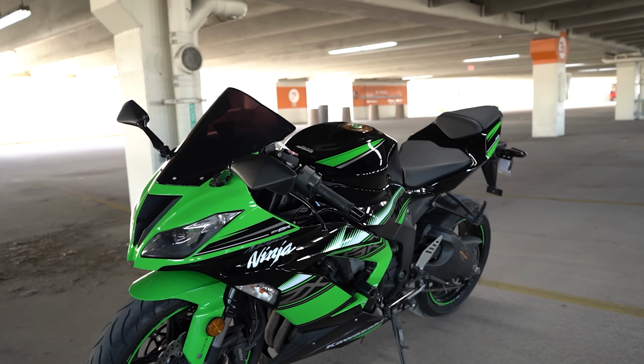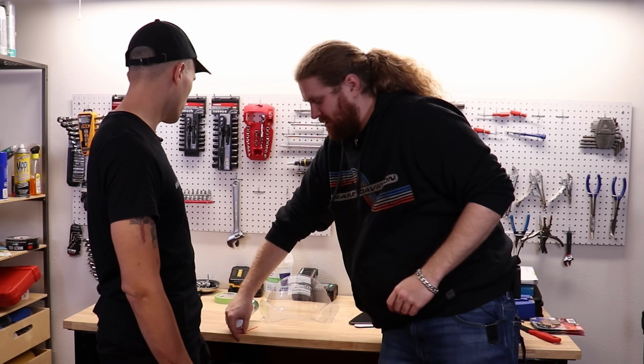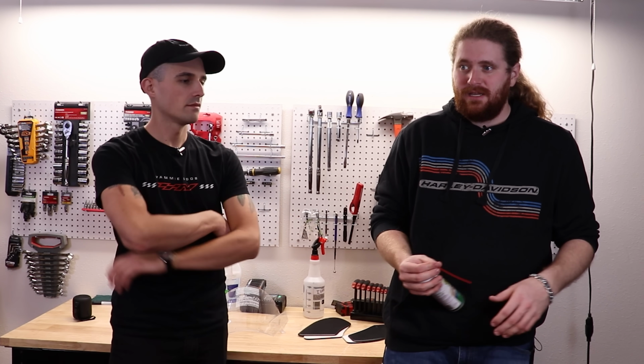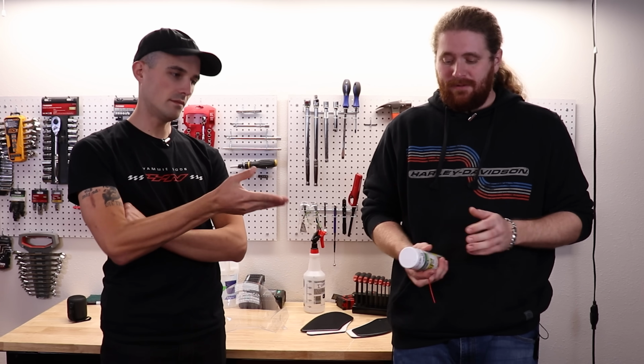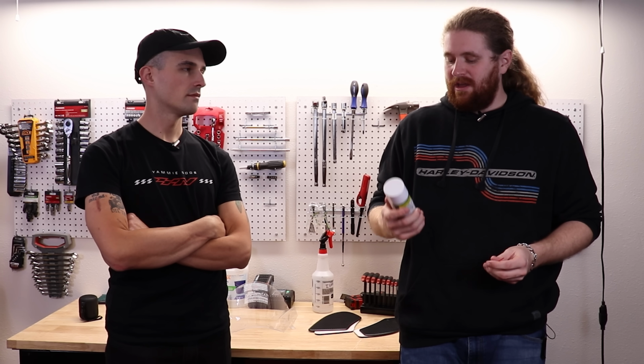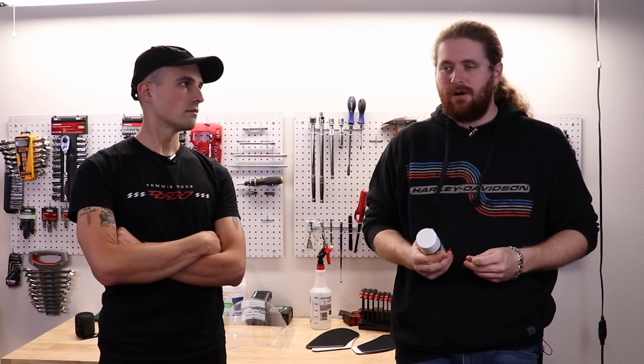Do we have any other mods? Yeah, so one thing you should be doing a lot on your motorcycle, especially if you ride in drier or dirty conditions, is cable lube. Yes. So we bought a thing of cable cleaner. Normally, you would also have a little tool that clamps on. We don't have it. You do this without, it's just a little bit harder.